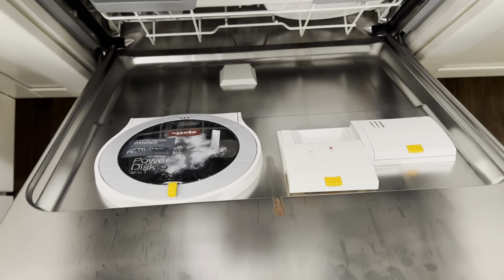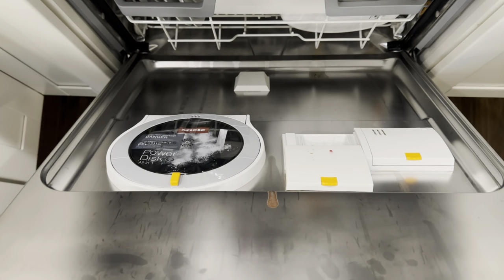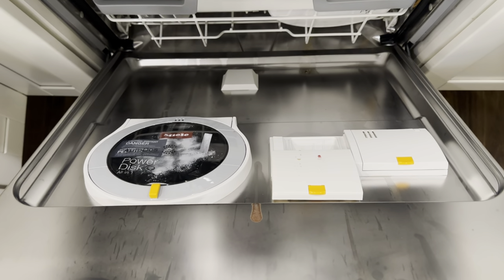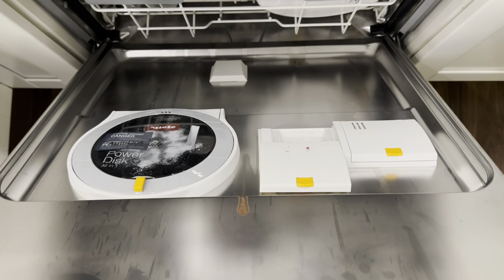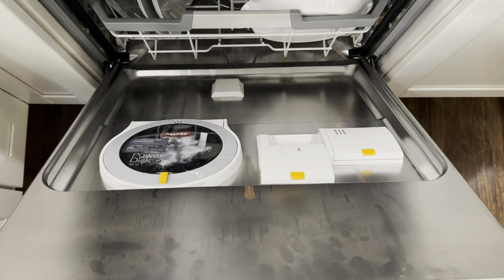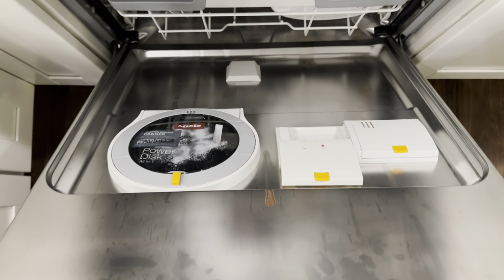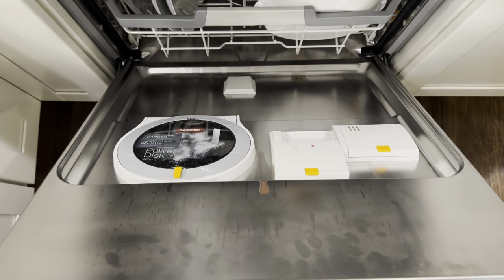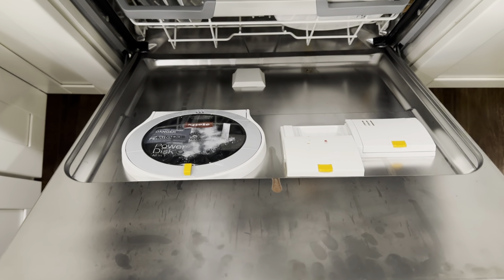So there's the Auto-DOS. You get a voucher for six discs for free in addition to the one that comes with the dishwasher. They last about 20 cycles, which I found reasonably accurate. The detergent inside seems to be fairly standard dishwasher powder — I've seen people refill these with Cascade Complete Powder and I'll probably do the same. They're a little too expensive at $17 each or $100 for six. There's no DRM in these cartridges, so the machine doesn't really care as long as there's good quality powder inside.